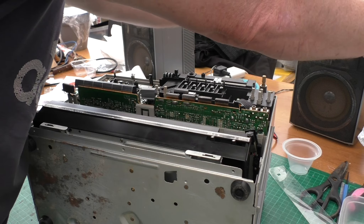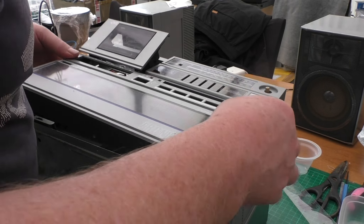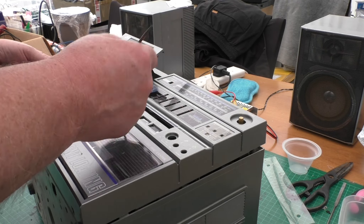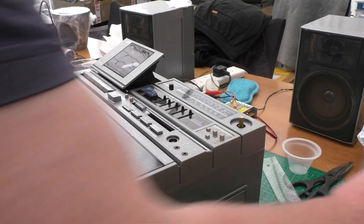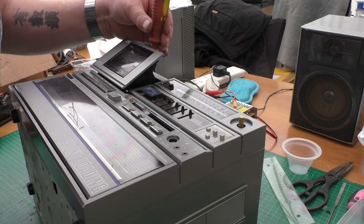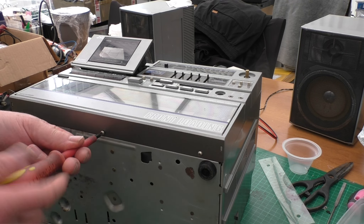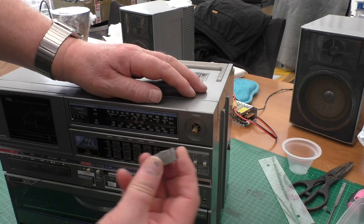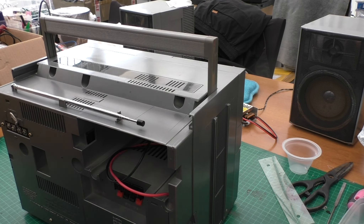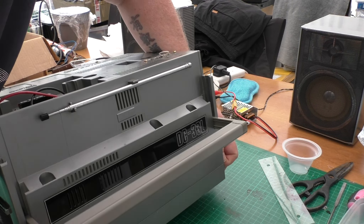Make sure the cassette door is open - it's just a question of getting these all lined up. That's all in. Don't forget this most important screw - it goes in the cassette mechanism. Then three screws at the bottom. Put the tuning knob back on. These two larger screws at the rear - I find it easier to do it laid down on its front with something underneath there.